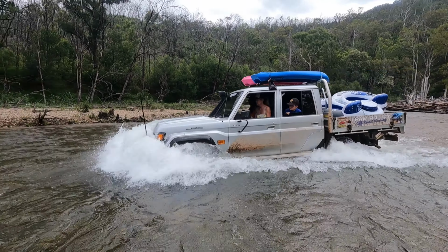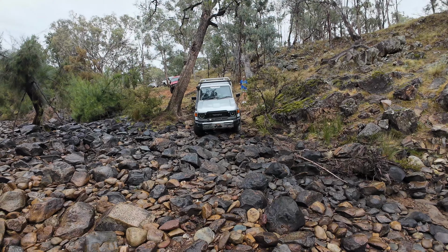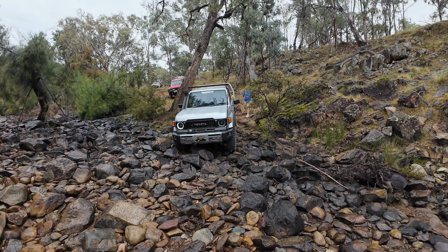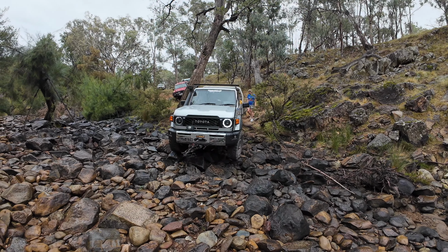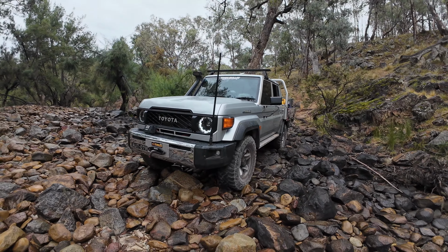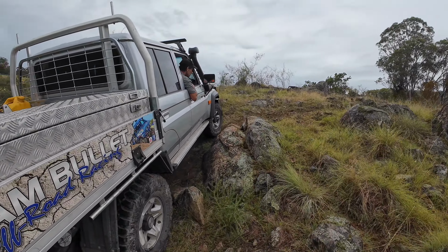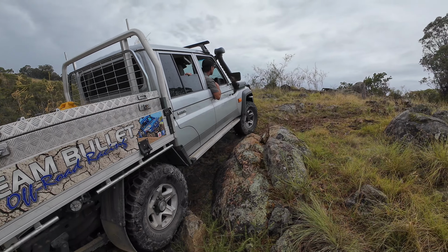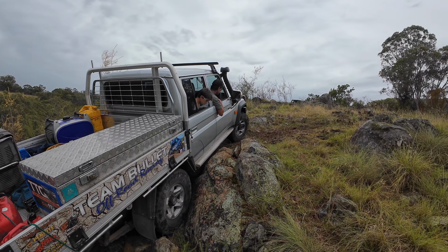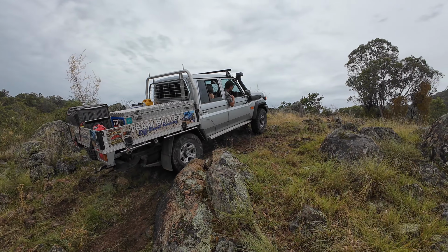And yeah, there's a couple of things that I call my pet hates. The first one is the headset on it, the radio. The Apple CarPlay doesn't work. Every time I turn the ignition, it's a guess how long I'm gonna have power to the head unit. The other little complaint I've got are the brakes. Now the brakes on this model are not as good as the 22 model. They actually feel a lot more like the 2016 version where the calipers were smaller. They heat up real quick when you're towing downhill. So I'm gonna look into that with my parts guy to see if the caliper on this is the same as the 22 model or the 2016 model.